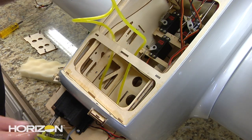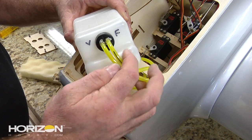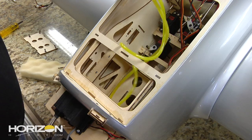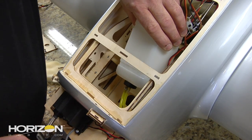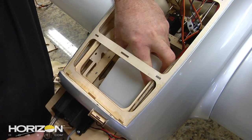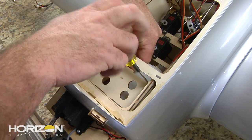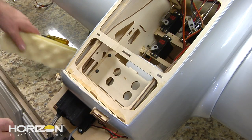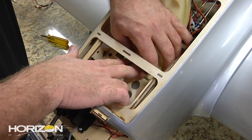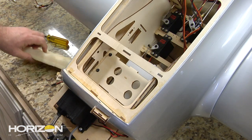I've already snaked the lines through. Here you can see we have F for feed, V for vent, and I have one black line on the feed tank so that when it comes through I know exactly which one it is. The tank's designed to just drop right in place. I go through the holes and put the top bracket in place. Our tank's installed, and we'll work a piece of foam underneath the tank to ensure it can't pop up and come loose in flight.